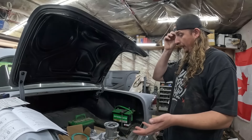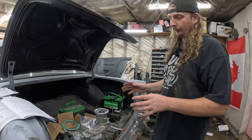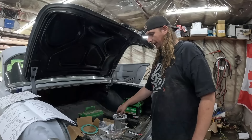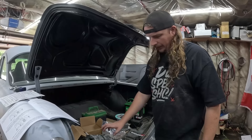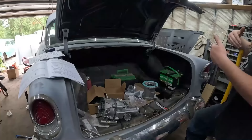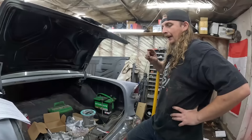I'm just kind of guessing here, assuming the vendor will go in the back of this and hang off the back of the transmission. There is some stuff you have to do with a straight edge to the gear vendor, make sure it's spaced properly. There's a little gasket, and this just takes gear oil in it. It's going to have the same spline — turbo 400, 32 spline — out the back. So we'll be shortening our drive shaft. Basically it's a real fancy tail housing that has overdrive.